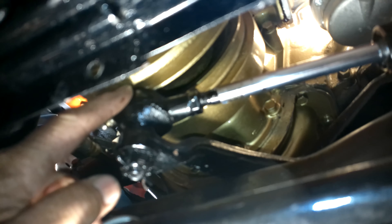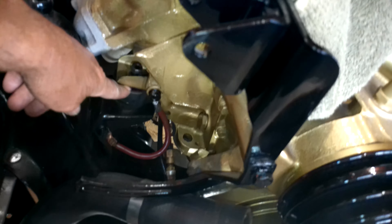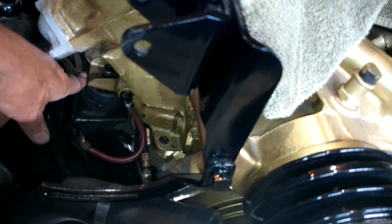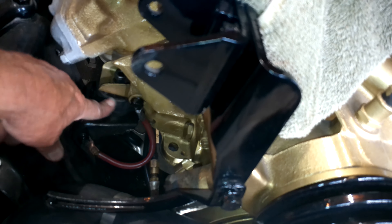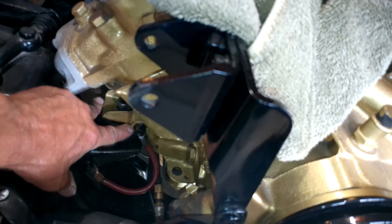So I don't know if anybody ran into these issues. I'm going to try to jack the engine up a couple inches. And I think that's why the previous owner - Goober - put washers between the rubber motor mount and the engine mount. They were just regular whatever-size washers, not very big. So I think I've got good selections of big washers. I'm going to find some real big washers that are about the same size as the washer bonded to the rubber, so I have a better surface-to-surface contact.